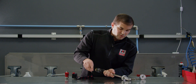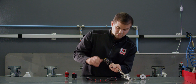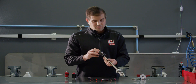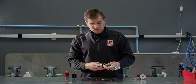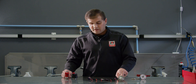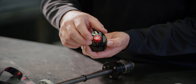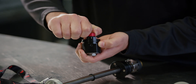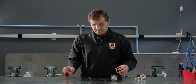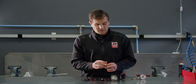You can see how when you add sweeps — adding rebound — the cage gets a little bit stiffer and tighter. With this adjuster you usually have around 10 to 12 sweeps, and it's actually creating thousands of pounds of adjustment on the dyno graph depending on the valving. For our reservoirs, you can do a non-adjustable, single adjustable, or double adjustable reservoir. Our single adjustable reservoir uses a little barrel valve with six positions — one is the softest, six is the stiffest — and each position allows different flow patterns through the adjuster. Then we have our CD4 adjuster, which is our double adjustable compression adjuster found on a lot of our four-way shocks.